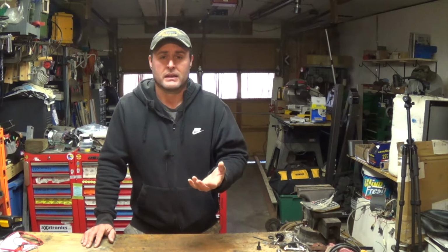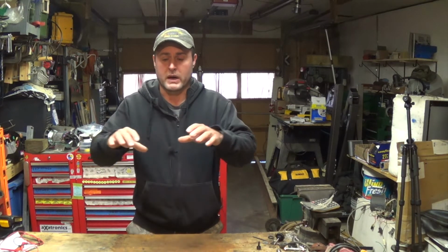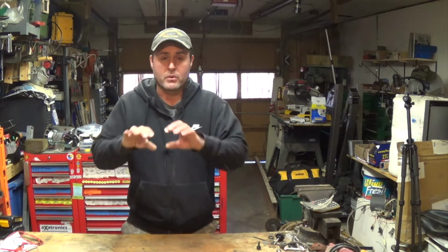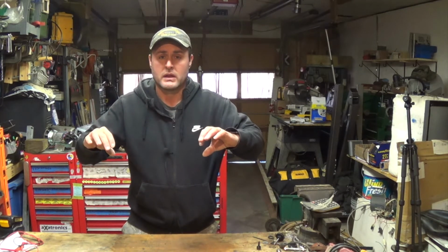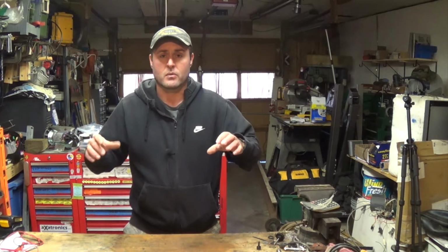And it just didn't seem like a carburetor issue the way it was happening. But I basically diagnosed it down to a manifold gasket. My lawnmower has the one carburetor that branches off and goes to both sides of the engine through the manifold. I saw online somebody saying you could take some carb cleaner and, right where the manifold goes up to the engine, lightly spray it around the edges of that while it's running.